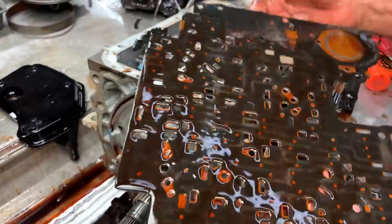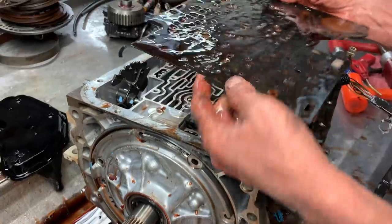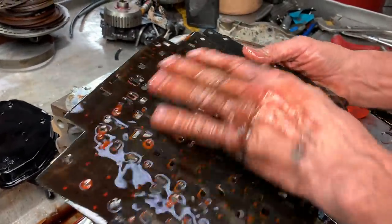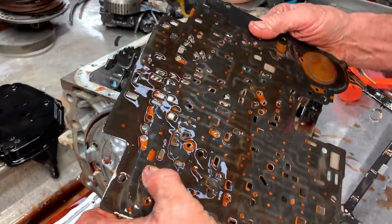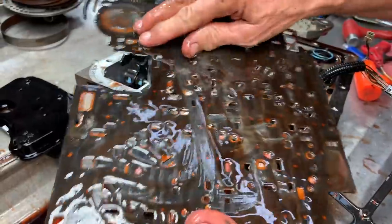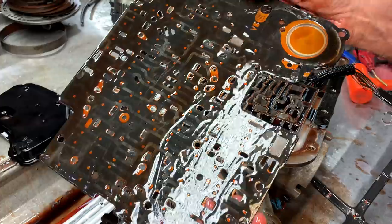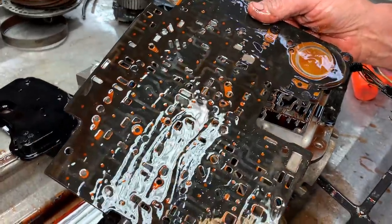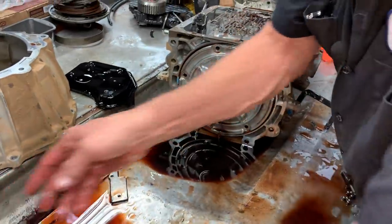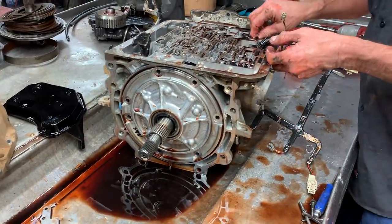We will not grind this gasket off. We'll put this gasket right back on. Some of them have an indention. You kind of feel it, kind of lock it back in place. But these gaskets are so hard that even being tightened down before, it didn't indent it. It's just really almost flat, like it's never been applied. Wow. So don't try to grind it off and put a gasket on it. They do have gaskets that'll come in your kit, but you'll end up destroying the plate, and then you'll be looking for a plate.